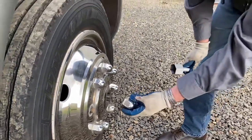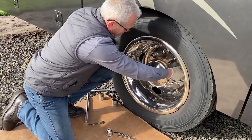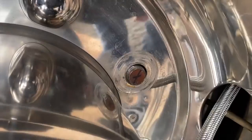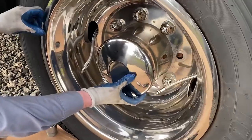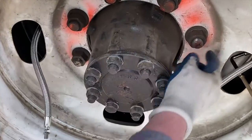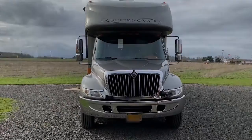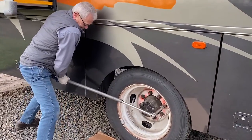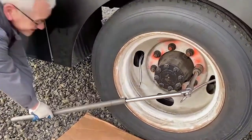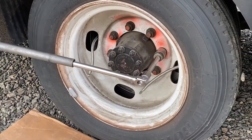So that's what we've got to address on the back hub. I'm going to loosen this other nut and get this wheel cover off. As you can see — same thing — just a tiny tiny bit. Here's what we've got, marked right here. You can see we're going to have to do something to get that more like the front.